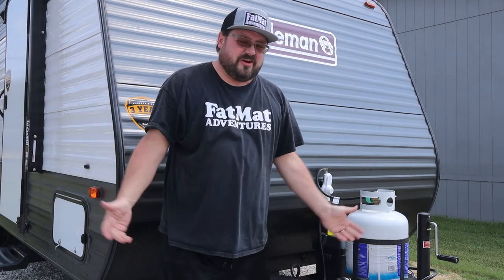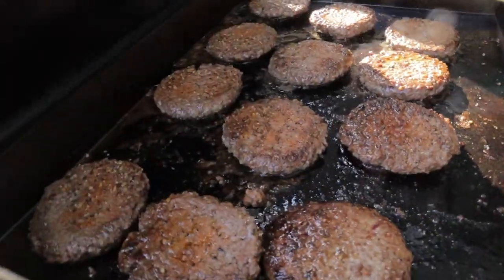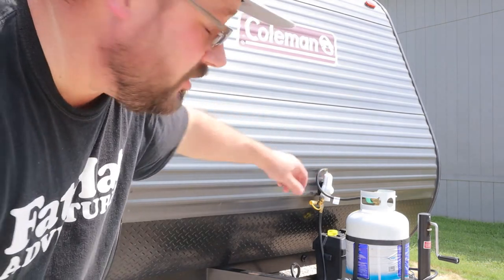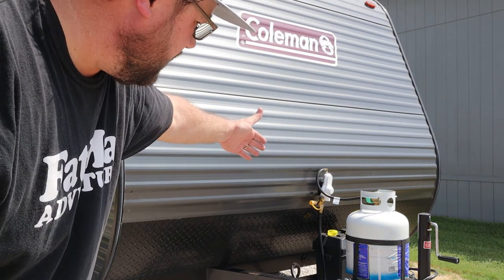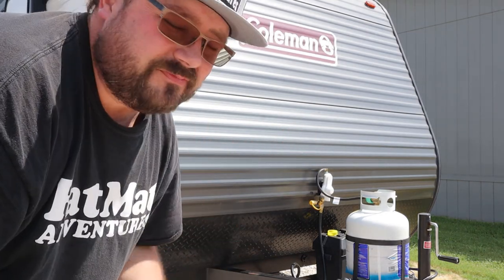That's it — very, very simple. My only recommendation, pro tip: don't do it when it's a thousand degrees outside, it's really hot. So I've got my quick connect here for the camper, so I can plug in my gas stove whenever I want to and cook outside. The only thing I'd recommend is to take yourself a squirt bottle with some soapy water in it, turn the propane system on, and squirt the spray all around the connections that we just did. You'll see bubbles if there's any leaking. I just wanted to show you how easy it was to install the propane quick connect — can't wait to start using it. Thanks so much for watching, I hope this video was very helpful. We'll catch you next time. Bye.